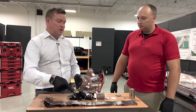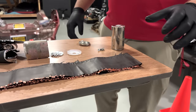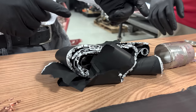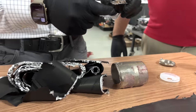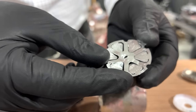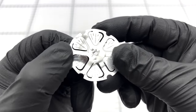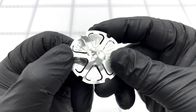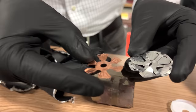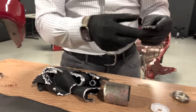On the other side — the anode — copper is a more noble metal, so it'll be more resistant to corrosion in anodic environments. Aluminum is better for the cathodic environment where it's not going to corrode — it's actually kind of protected. On the top of the battery cell you have a similar piece with the same type of laser welds in the exact same pattern. What's interesting is you have six little tabs connected on the outside instead of from the center — a slightly different design — but this is aluminum being welded to aluminum, and copper being welded to copper: a similar methodology.